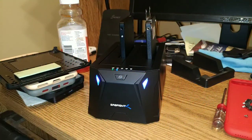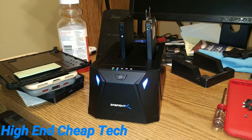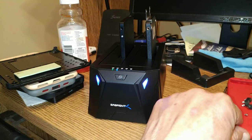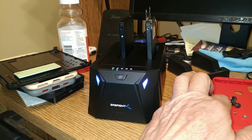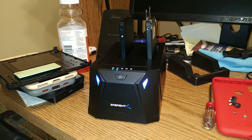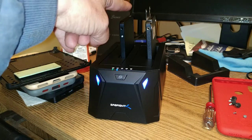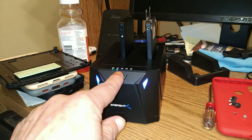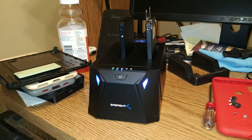Alright folks, we're cloning. I went ahead — no matter how tired I felt, I said I've gotta do this tonight. This little magnetic screwdriver kept me from losing any screws. I need two to bolt her down and four for the bottom — they screw in by hand. We're 25 percent of the way through already. You put your two drives in: this is your source, this is your receiver — your new drive you're cloning to. Hold that button down, the unit comes on, then quickly hit the button one more time to go into clone mode.